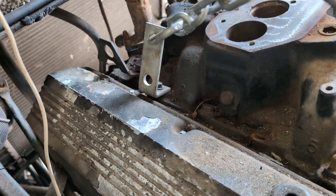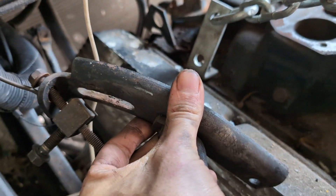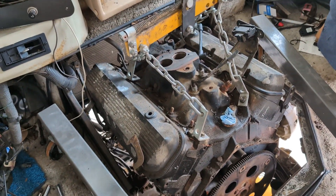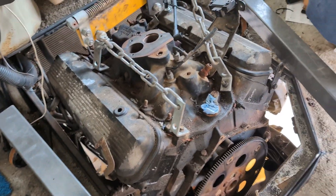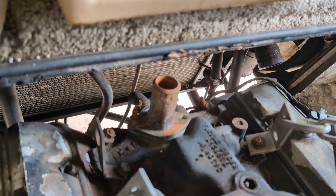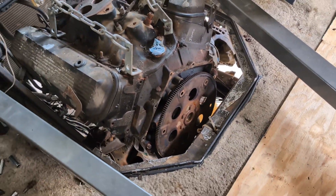For clearance purposes, the bracket for this — air conditioning, I believe — I had to take that off, 9/16ths nut. And look at that — they said it couldn't be done, they said it shouldn't be done, and I may agree with the latter. We're doing it. The engine is coming up and out, looking pretty good. We're a little concerned about the water neck contacting the edge of the doghouse, but we're going to try to roll it back and sneak it out.